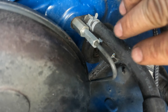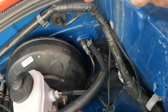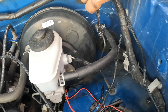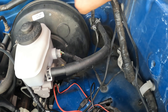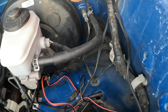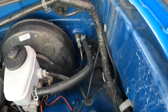Here are your lines — disconnect right there, then use a pair of pliers to take the hose clamp off. That hard line fitting is a 10mm and it breaks loose fairly easy, which is good. I'm going to take this off so we can pull the clutch pedal backwards, and we should be able to disconnect everything once we get the clutch pedal out.